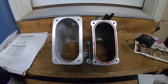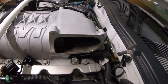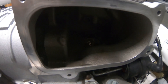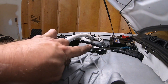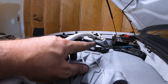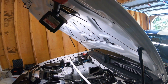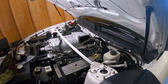Hopefully this thing will make some power. I'm not going to freak out about the oil — it was not a lot of oil. You can get the camera in there and see everything looks clean and intact. Just a little bit around the gasket surfaces. My guess is I have the second gen JLT catch can, and it's just letting a tiny bit of oil in there, seeping through when pulling under load. I went ahead and cleaned that out anyway.